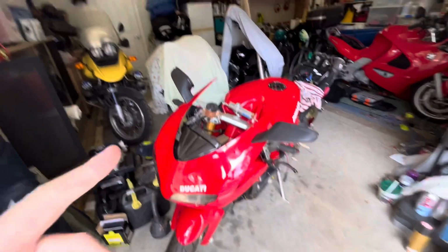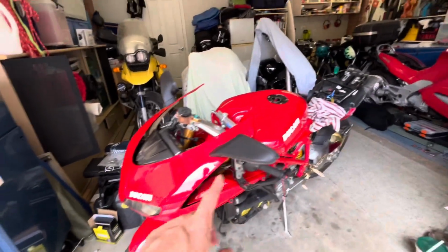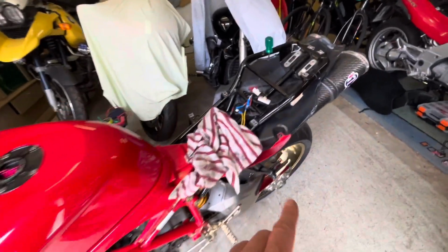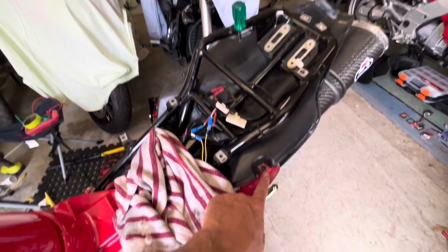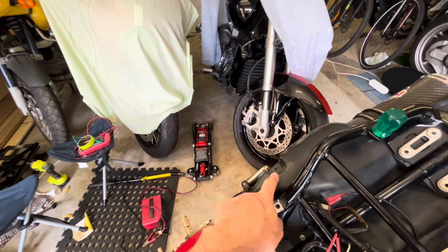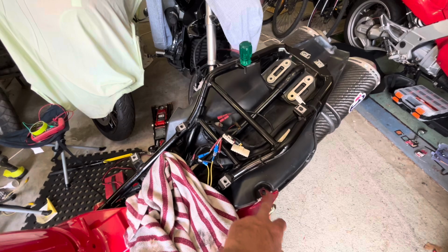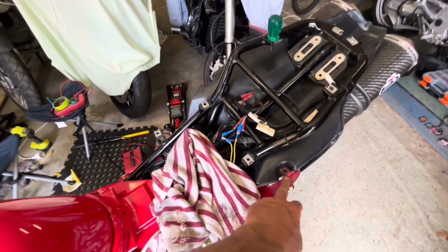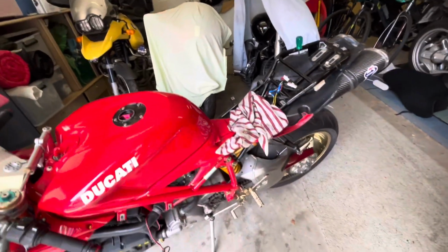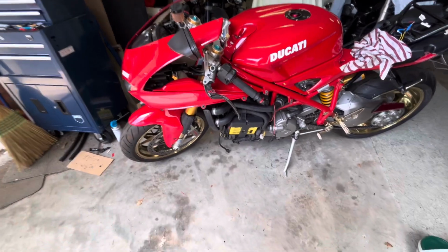Well guys, you would have seen us put some of the fairing onto this. We've got the nose cone on, got some of these smaller pieces. We've made a little bit of a tidy up. You can see on this one, the tab on the other side, and we haven't got it on yet, I've had to just put together a bit of a washer onto the fairing and just using araldite to create an equivalent tab. So I've done that on the other side. We'll let that dry, of course, and get strong before we do anything else. But before we do any more fairing, it's time to do an oil change while we can get to everything.